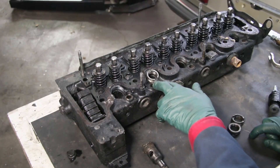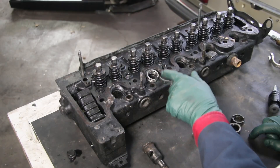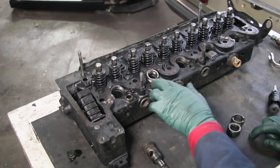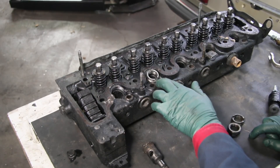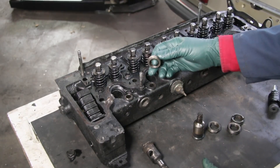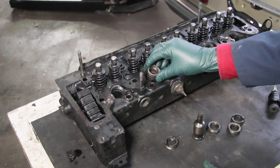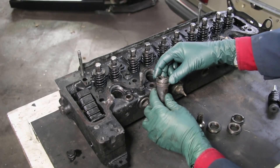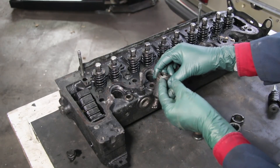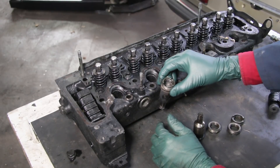The second alert concerns small fuel leaks coming out of the cylinder head right below the fuel injector. You may see a few bubbles along with fuel seeping out in this area. It has to do with a loose collar nut. The collar nut holds the pre-chamber down in the cylinder head. When the collar nut loosens up, the pre-chamber will back out and you'll eventually get a little bit of unburnt fuel coming out. A lot of times you can just tighten the collar nut back down and that will solve the problem.